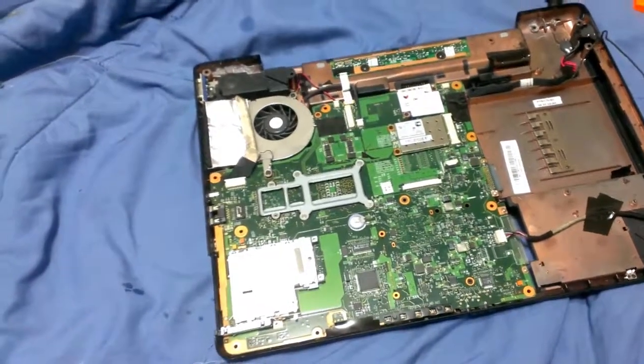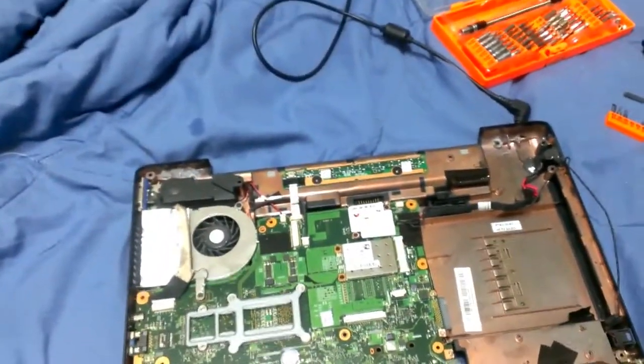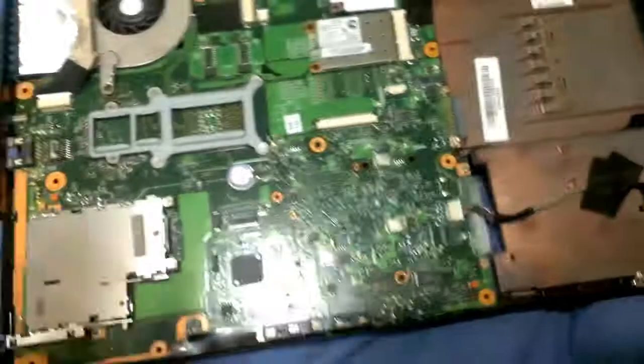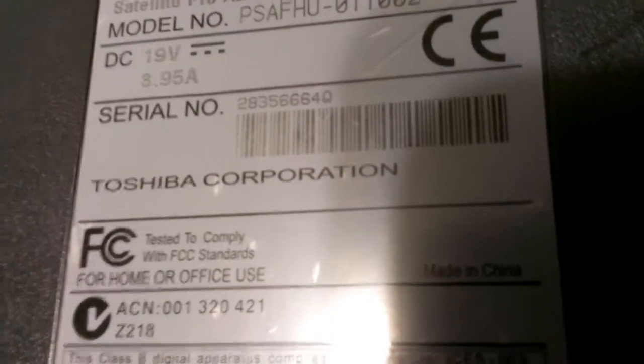Her laptop is fixed. It took me about half an hour to get the part out because I kind of forgot how to disassemble the top half. Note to self: always remember to rewatch this video if you ever have to work on this again. You've got to take the LCD out first. Just so you know, this is the one I was originally working on — the Toshiba Satellite Pro A210-EZ2203X. I'll show the serial number on the next part after I get it all back together.